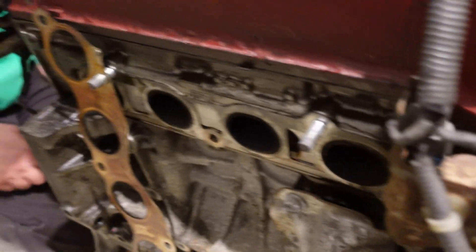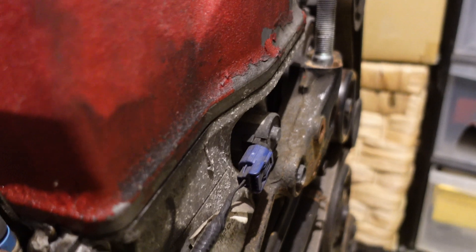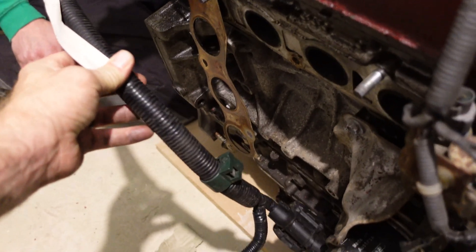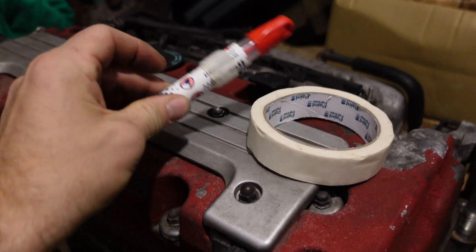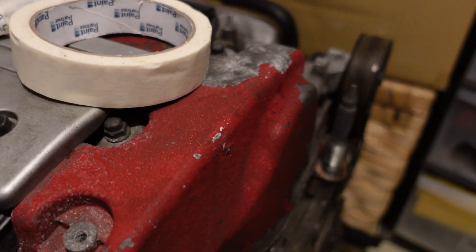Honda's craft to work on. It's got clutch on it — surprised it had, actually. We'll take it off and compare it to the other one. It should say Z4 on it. This will be the engine for the Jazz. Because this has the FN2 loom on it, we're going to swap it for an EP3 loom. We're going to mark up everything that is on this so we know where we are and what it was. That's probably the easiest way to do it. So these are the plans for the Jazz — this is the engine.